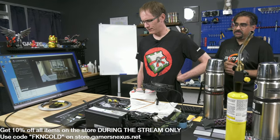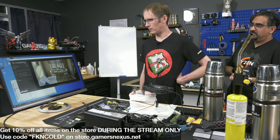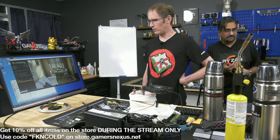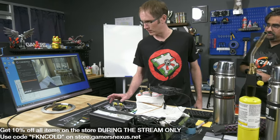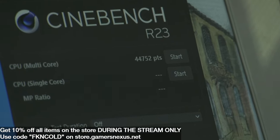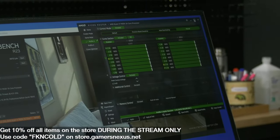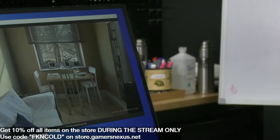We're at negative 147C now. Same frequency, same voltage, everything the same. We should be good here. That demonstrates the effect of reducing the temperature - that test passed and it would continue to pass without changing anything else. In fact, we could probably bump up the CPU frequency a little bit now. No more voltage - it's at 1.3V - but we'll make it a little bit colder and see what happens.